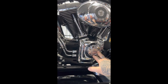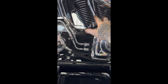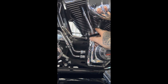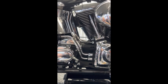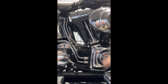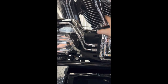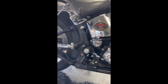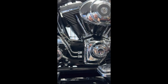Due to this bike being pulled down for what it is, it doesn't have adjustable pushrods, so what we'll be doing is taking the covers off, getting in, and cutting out the old standard pushrods. This will have an update to an adjustable pushrod. The reason being is by the time you take the tank off, get all your rocker boxes off, rocker gear out, everything to pull out the standards — there's obviously time consumption in that. So it's easier just to get in and cut these ones out. We'll get the bike on top of dead centre, which I'll show you guys, and then we'll update in here and go back together.